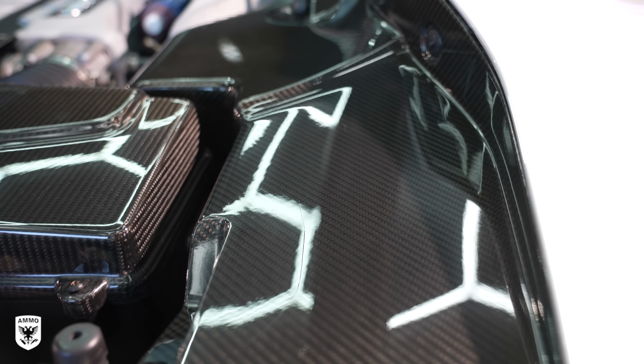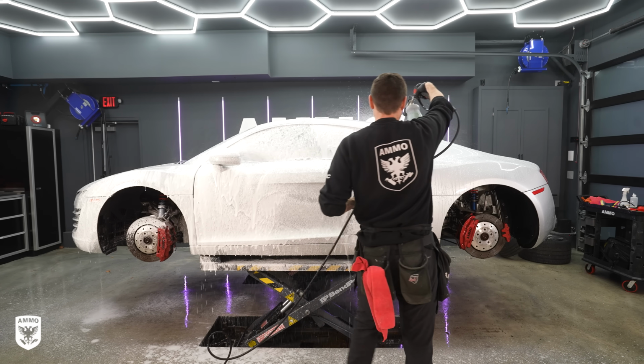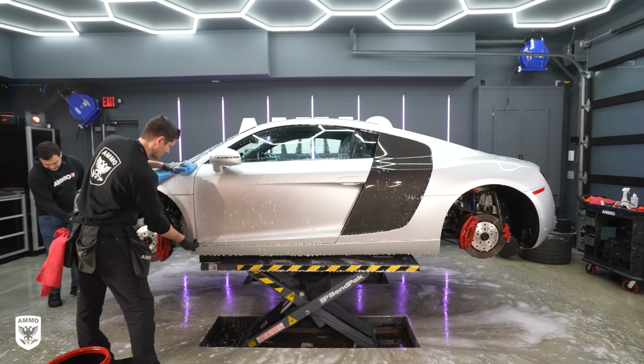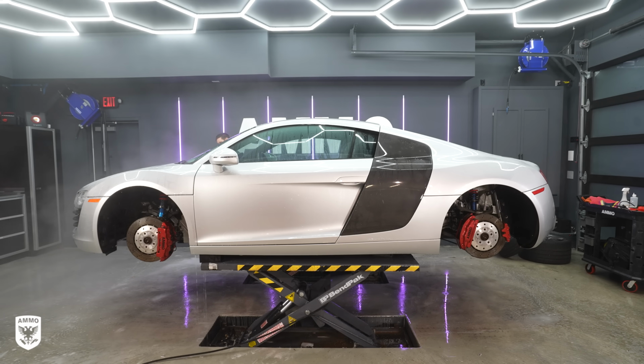Okay, just on a quick side note here, after a full car polish, and especially before you add clear bra, you must rewash all of the seams and creases and crevices, that sort of thing, to release every bit of trapped dirt to avoid it sticking to the bra during the application. And if you stare at it forever underneath the PPF, it'll drive you nuts, so do the work now.